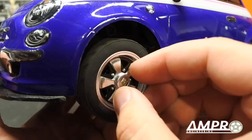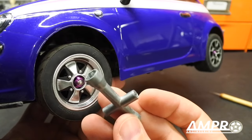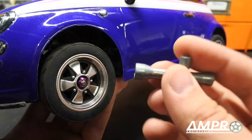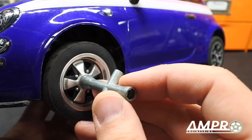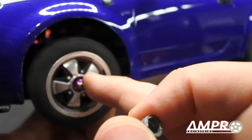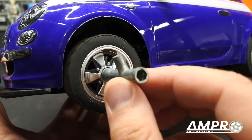At the rear we have our central lug nut, and at the front we don't — it's just a little cap that pops right off. I want to mention that I designed these wheels around this lug wrench. Do not use some oversized or heavy-duty one. This will barely, barely fit in there — the clearance has got to be fractions of a millimeter. So be careful. Test fit this first. You don't want to overly paint this and make it too thick so that the wrench does not fit.